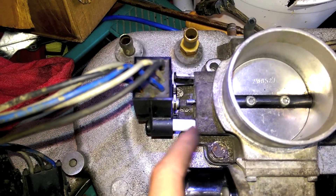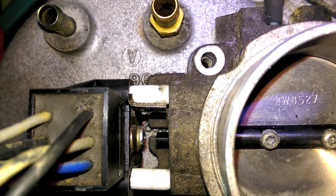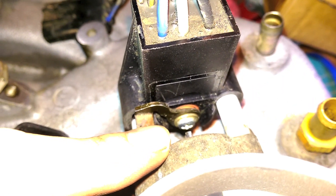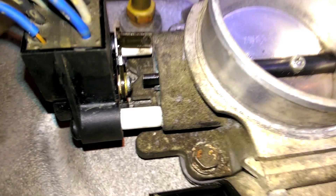Just mocking this up real quick. This is a 5/8 inch spacer which is just enough of a gap to keep that arm from touching the throttle body itself. We can still hit this far — if we fully extend it out we still have just a little bit of gap. All you'd have to do is figure out how to connect the arm to the throttle body.